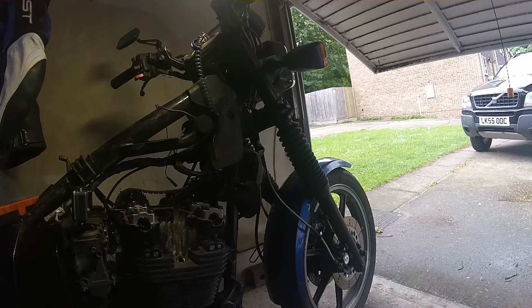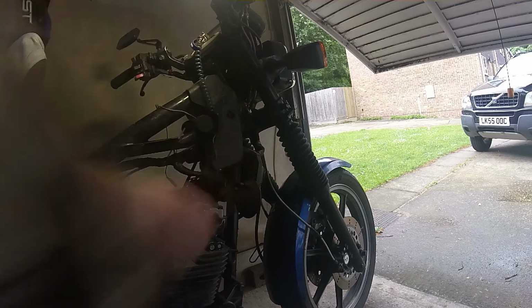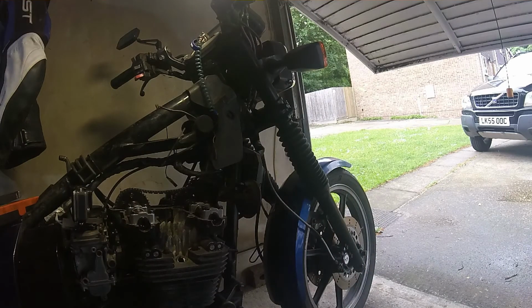Yeah, so we'll do it the way they tell you to do it, because I suppose you want me to do it properly. But just so you're aware, there is no real need to do it on the timing marks. It's just a neutral position on those cams, so the lobes are not touching at all. So let's find what size spanner we need to turn the engine over first. It's neither of those two, obviously, because they're the ones I grabbed first.